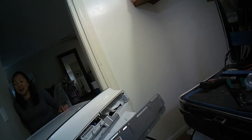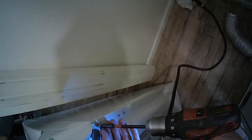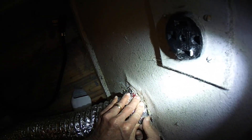Now we're putting in the remaining quarter-inch screws and then the back panel that goes on the back of the console — that also has quarter-inch screws we'll zip in. Those hold the panel but also help hold on the front panel too. Now we're hooking up the vent tube to the dryer and putting it onto the wall. We'll reach in to make sure there's no obstruction or lint left over, then put the vent tube onto the wall, secure it, get it plugged in, and push it back against the wall — making sure we're not squishing the vent tube.